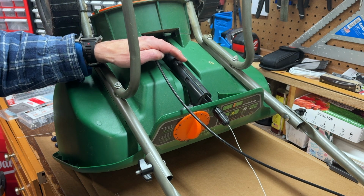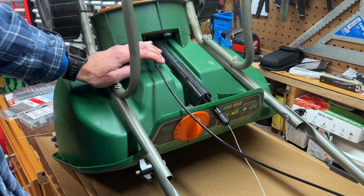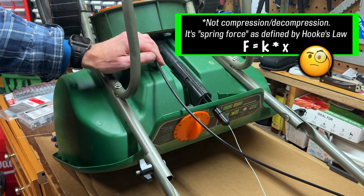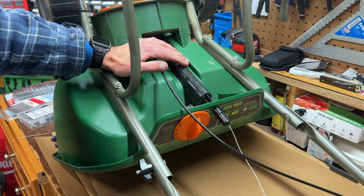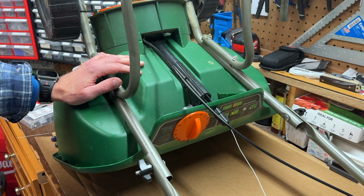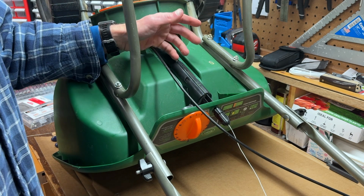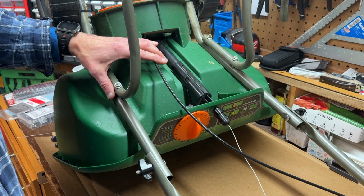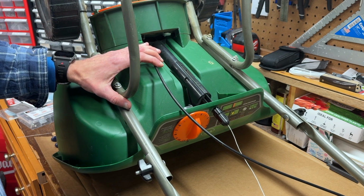Inside the chute mechanism, there's a heavy-duty spring that gets compressed when the chute door is open, and once the handle is released, the spring inside decompresses, closing the chute door. The spring could possibly get weak over time, but I've had this spreader for over 10 years and there's plenty of tension. I mean, it's never been a guillotine, but products with large prills are going to jam it either way. Happens with most spreaders.